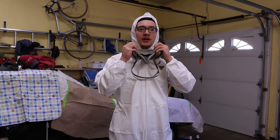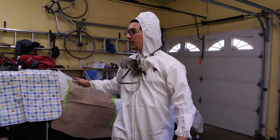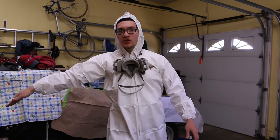That's what I have right here. If there's anything you don't want to get painted, get it out of the garage or cover it up. Overspray does travel. There's not going to be wind in here because everything is sealed, that's why I wanted to do it in the garage. But still it will travel, so you want to make sure it's covered. I have the car pretty well covered. I won't be spraying too much in the upward direction, mostly down or straight to the sides.